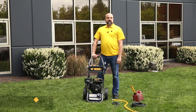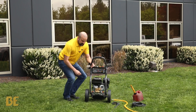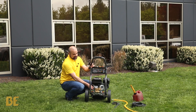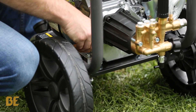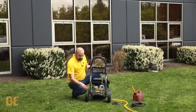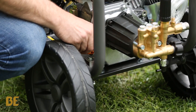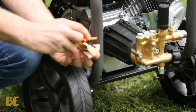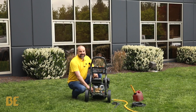The first thing you want to do is check your oil. This one has a sealed pump, which means there's no sight gauge or dipstick for the pump oil — in this case, you're good and don't have to worry about it. For the engine oil, you always want to double check. There's a little dipstick to the side of the machine. Pull it off, wipe it clean, and do your test by dipping and checking. You want the oil halfway up the dipstick. If you need more oil, use 10W30 motor oil and top it off.